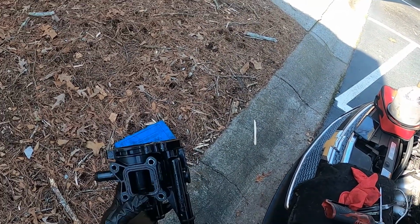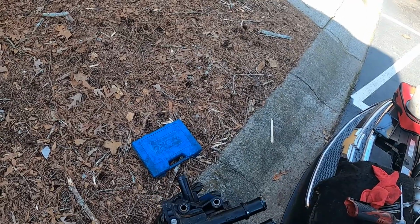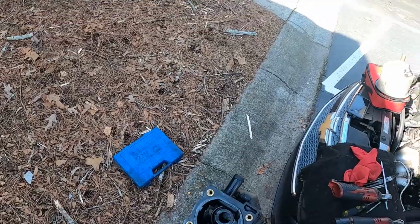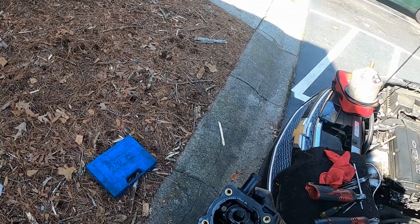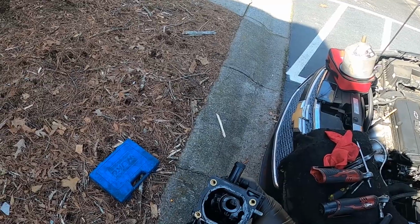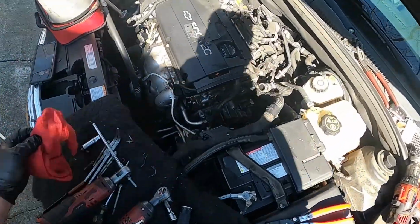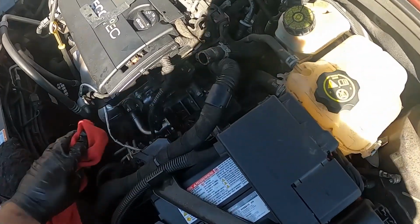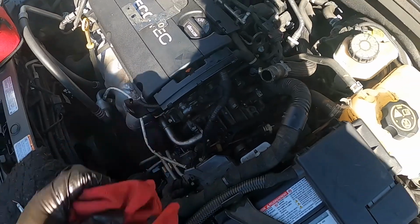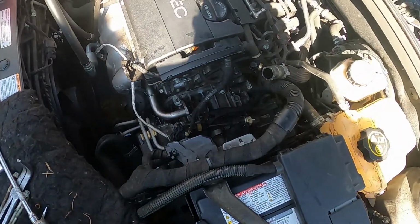They'll split down here. They'll split over here. They just like splitting everywhere. So, like I said, there's no seal or anything like that right here. So just put just a little bit of RTV on here. 2 bolts in, be good to go. So I'm gonna put some sealant on the assembly over here just the same. So that way it prevents any kind of future leaks.